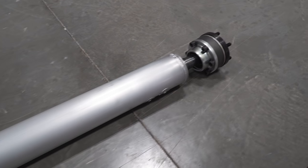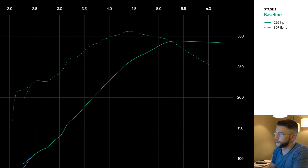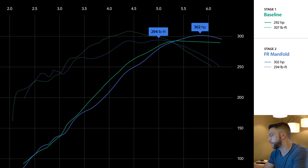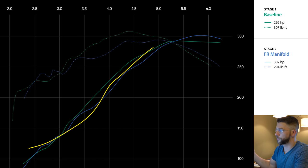The next chart has all the stage 2 parts on the car, which includes the long tube headers, X-pipe, one piece aluminum drive shaft, the new throttle body, and the Ford Performance intake manifold, also running another Bama tune. Now immediately you can see this is very disappointing. While the car did eke out 10 more horsepower above 5,500 RPM for a total of 302, I lost 13 pounds of peak torque at 4,400 RPM. Looking closely it's more like 20 to 25 pounds lost across the range — when you've dumped that much money into your car, that looks like the Grand Canyon. Some might say you need to get camshafts, but if I do, all my power gains are going to be above 5,000 RPM and I'm just going to lose more torque in the low to mid range.